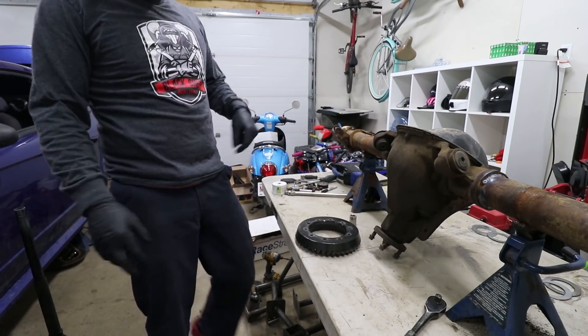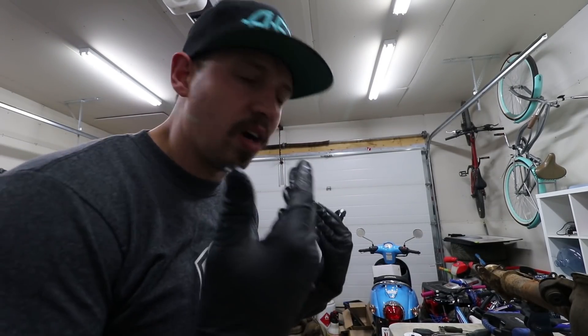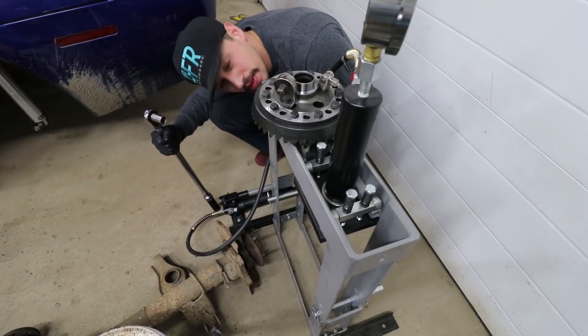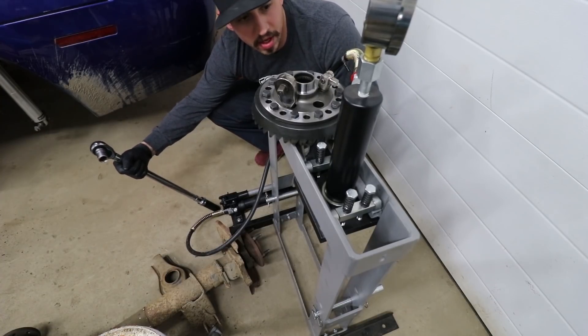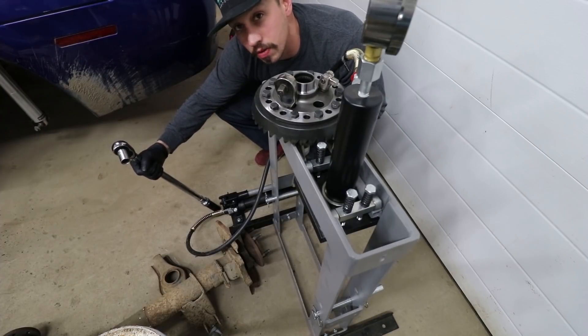Also, I've been getting quite large so I had to take the top button off my pants. With all the gyms closed I've just been eating through my mouth all day, and then obviously it has to go somewhere. So this is our ring gear on the spool. Sometimes you just have to be innovative when it comes to torquing things because I have nothing to clamp this into. I'm just going to use this press as a sort of thingamajig to hold the spool while I torque it — a couple steps up to 100 foot-pounds.